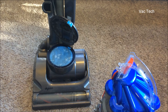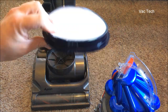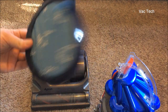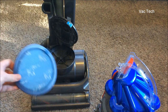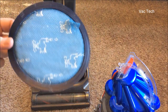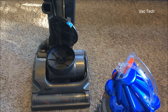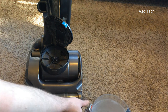The filter took forever to get dirty, and this was a much nicer filter than they were using before. This uses a really good seal with a fat gasket — I think this was the first upright to use this type of setup. Because it was completely sealed, very little dust would make its way to the huge HEPA filter. It's washable and takes forever to get dirty — I think the last time I washed this was two or three years ago. It was a huge step up. The system did have one inherent flaw, though.